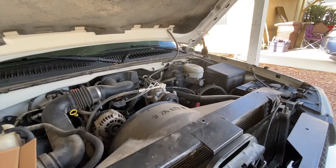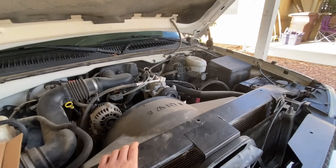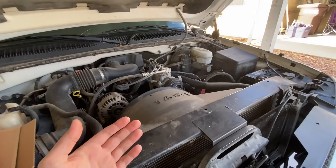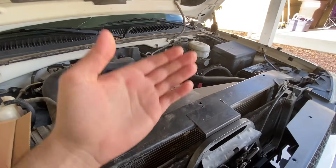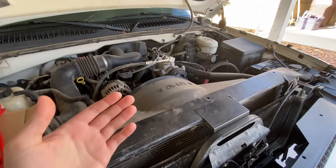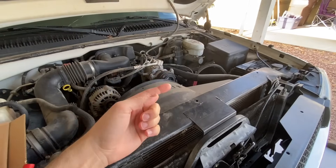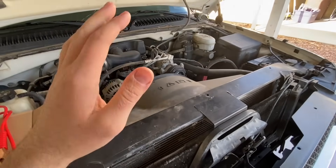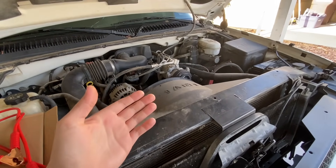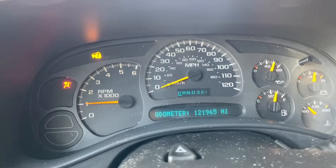Welcome back to the channel. In today's video I'm going to show you how to reset the ECU, the TCM, and all control modules in your car or truck. Before I start, I want to mention that some vehicles have more complicated systems and you're not supposed to disconnect the power from the battery. They're designed to have constant power — even when replacing the battery, they connect the new one in parallel before disconnecting the old one. Research if you can disconnect the battery. There should be no problem for domestic vehicles and some simpler imports like Honda, Toyota, and similar.